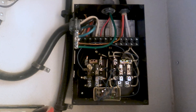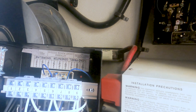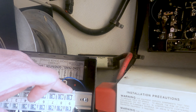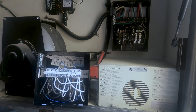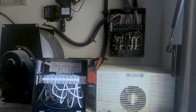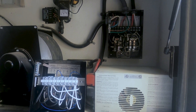We had 12 slots on the old style; on the new style we only have 9 slots. That tells me I have 3 for shore power, 3 for generator, and 3 for load. If you don't feel comfortable with this task, you can always hire it out — and you already did save a few hundred bucks in troubleshooting costs by figuring this out yourself.